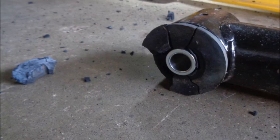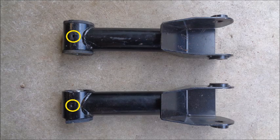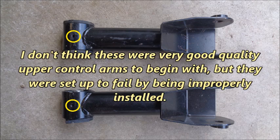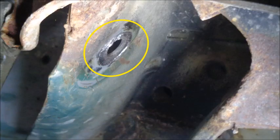Looking at Apokalypso's entry-level rear upper control arms, it's clear the two-piece poly bushings didn't hold up very well. Every bushing was dry or cracked, the sleeves weren't tight, and there was absolutely no lube anywhere. There were provisions for grease fittings, but they weren't installed. I don't think these were very good quality upper control arms to begin with, but they were set up to fail by being improperly installed. Normally this is a fairly simple remove and replace procedure, but the destroyed bushings allowed the upper control arms to damage the torque boxes.